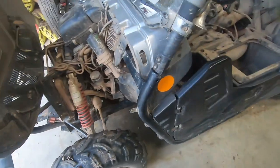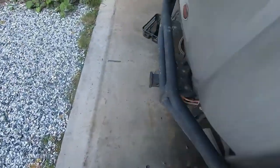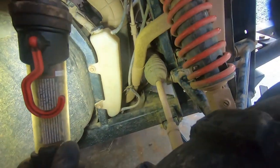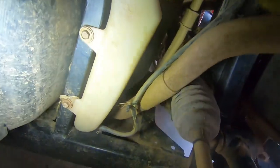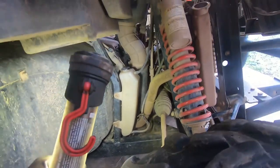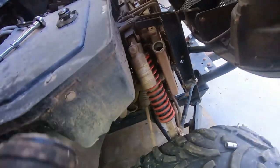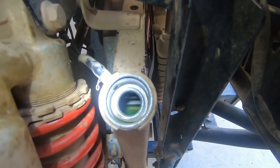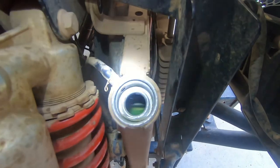It's not straightforward. The easiest thing is to check if there's coolant in the reservoir. The lighting's not the best, but I'm on the left-hand side of the machine here and there's the coolant reservoir and it's actually low. So that's the first thing to check. Make sure you've got coolant there and also open your radiator cap when it's not hot and not running — it should be full or pretty near full — and we have some air there.